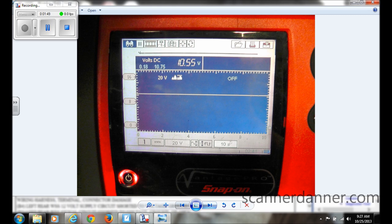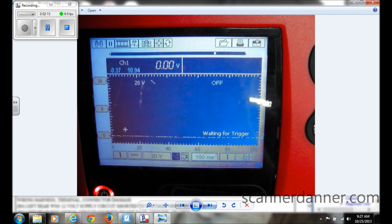What tells us it's digital is that one wire had battery voltage, and when we spun the wheel nothing changed — it stayed flat initially. Then we back-probed the other wire and it looked like a flat line at zero all the time. Spin the wheel, we have nothing. So now we're left asking: is it wiring, the sensor, or the computer?